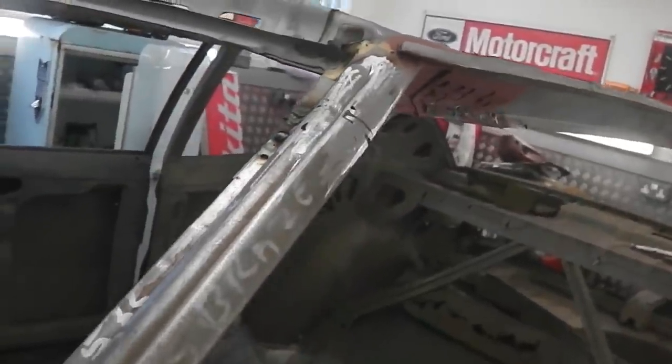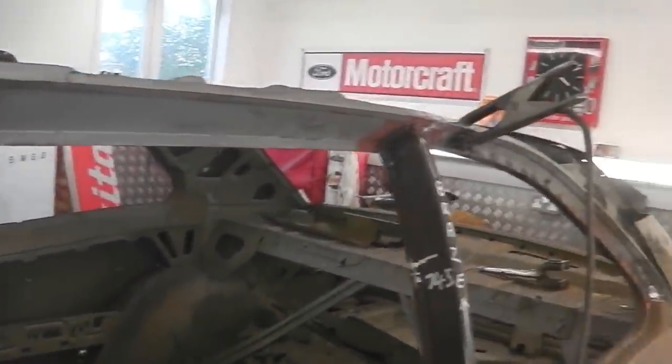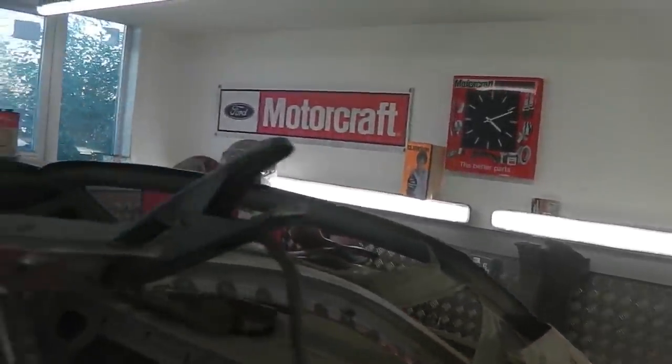Okay, A-pillar repairs. Getting ready to start stripping off the skin at the back next. Remainder of the door of the roof skin to come off. And then start tidying up some of the inner welds, get a bit of primer on if we have to, if all the welds are done at the top, just to stop that flash rusting, because that's just pure shot blasted.